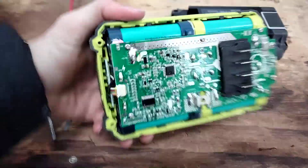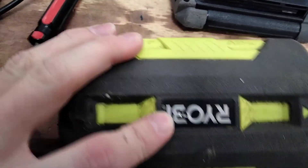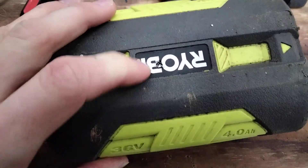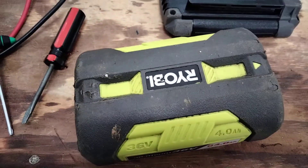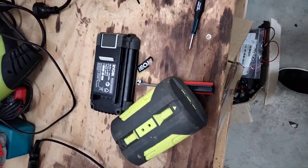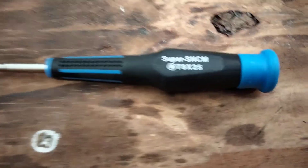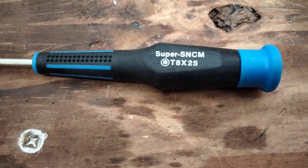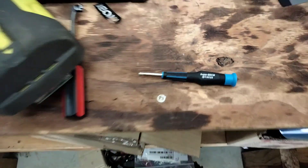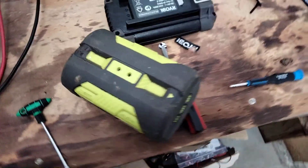I haven't been able to get it out, and I've discovered that's because they've hidden a screw — two screws actually — behind this lovely little sticker. After making a mess I realized that these two little screws require another security bit, a T8X25. So we'll get those out and then we can have a look at the battery.